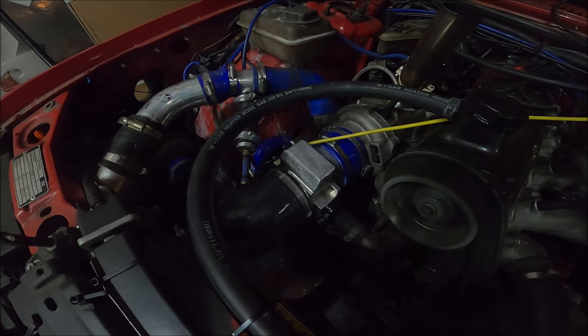Right, that's first test complete. You wouldn't have seen all of that because the battery died on the GoPro, but hopefully you saw some of it. And the answer is, well, good. Lag, as in true lag, I'm not talking about boost threshold. This has no effect on the RPM your turbo spools up at. I'm on about turbo lag between off throttle and on throttle within the boost threshold. Yes, it does work. I'm kind of not surprised because that's why Formula One and everybody does it. But yes, it does work.